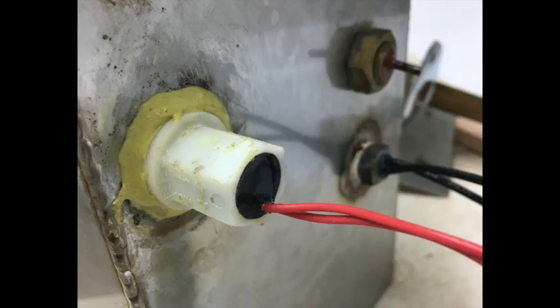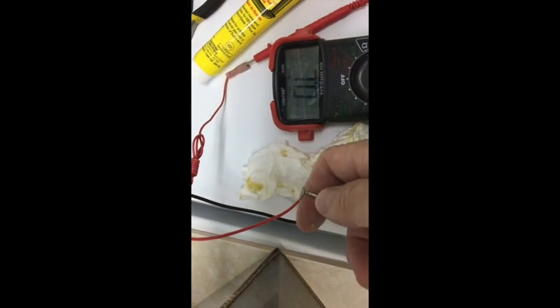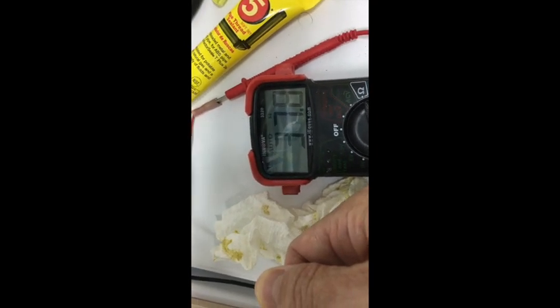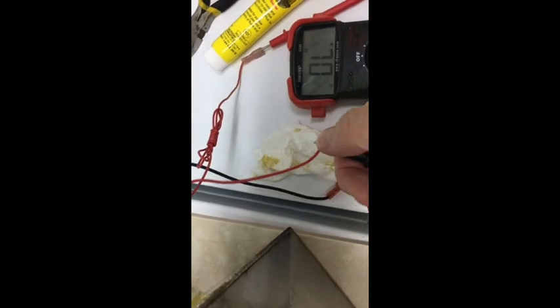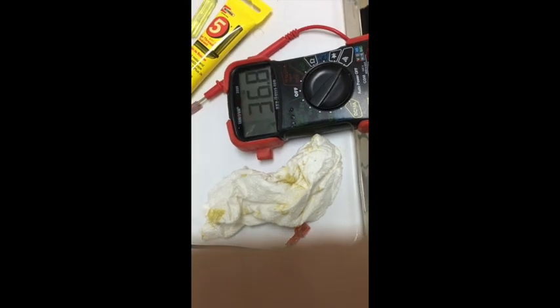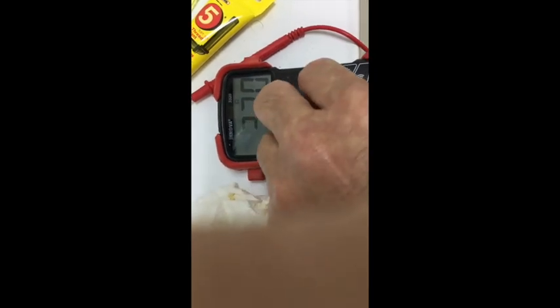Using a sealant, I threaded the float switch back in. I thought the float switch was okay and all I had to do was make sure it was sealed well, but when I tested it, it gave me zero ohms at first and then jumped to 38 — it's random and erratic. It should be zero ohms, a closed loop. When I put it on the continuity alarm it does work, but it's not reading zero. Here — not floating, now floating — it should read zero. I think this intermittent change in conductivity is probably the reason it was tripping the error.